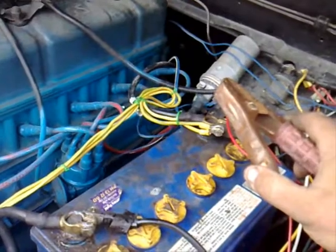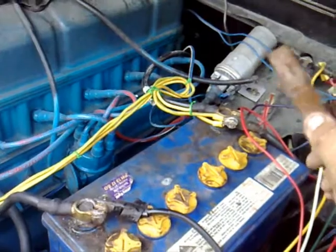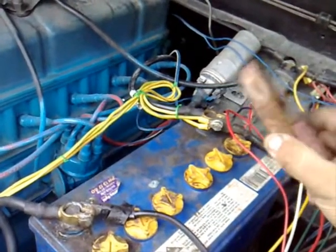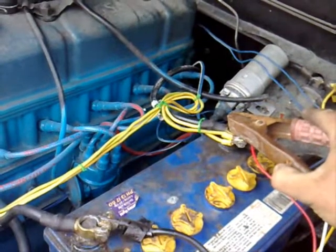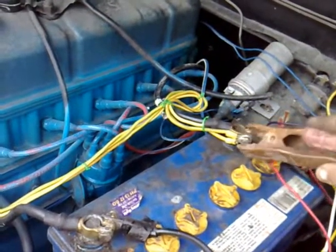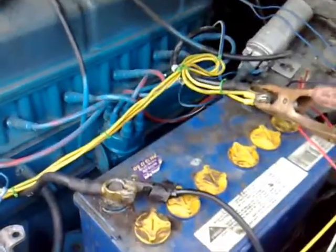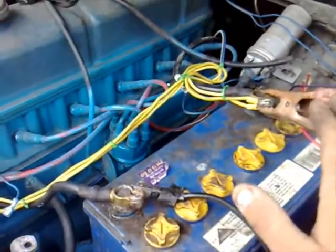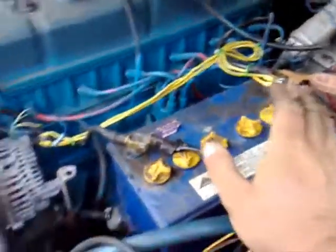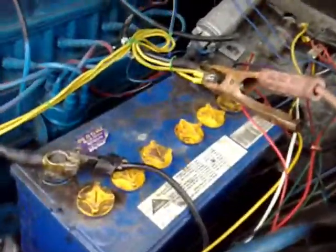At this point, before putting the positive terminal on, if I had another vehicle here I would start that car — and preferably have a second operator or a brick on the accelerator to bring the revs up to about 2,000 RPM, because that's where the alternator on the other vehicle acts as a booster pack. Then all we do is hook this up to the positive terminal like so. If the battery was dead flat, leave it sit for a couple of minutes then go and try it. If it's not flat, hook it up, check your headlights are nice and bright, then go and start the vehicle.